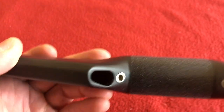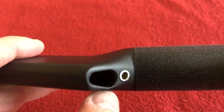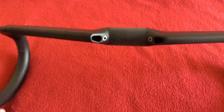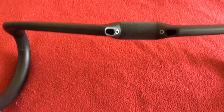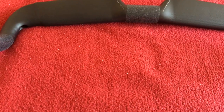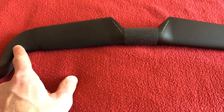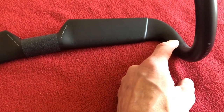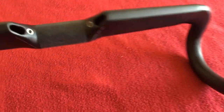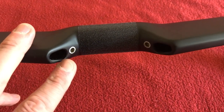Leave a comment for me — I haven't researched what it's for, I'm just being honest. There's enough space there for my hydraulic cable and Di2. The way I'm going to route it — the same as my other Aerofly bars — is I'm going to come up out of the bike, into here, along here to my shifter. Then I'm going to go from here through the bar to the other shifter and then to the charging port. So I'm going to do it all in one, with two hydraulic brake cables — front and rear — and bring the Di2 cable in through this side as well.